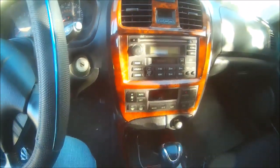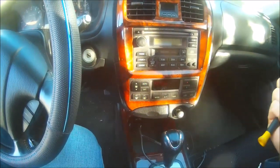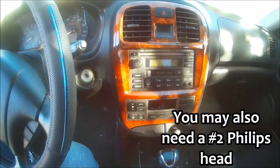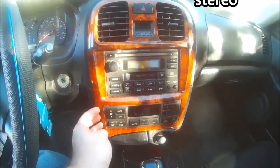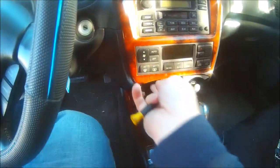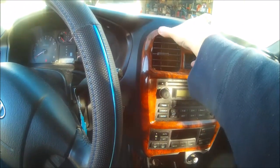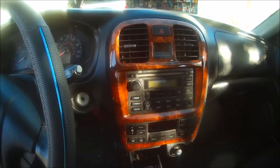The only tools we'll need — if you have a plastic trim tool to remove plastic components, use that. I'm going to use this little screwdriver since I can't find mine. I have a kit that does all that so preferably use that. What we're going to do is pop off this frame here. You have to drop your ashtray and then gently pry this off. You'll see there are four little metal brackets in here — be careful you don't lose those.